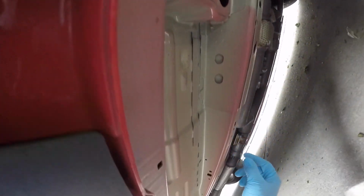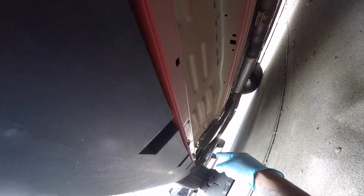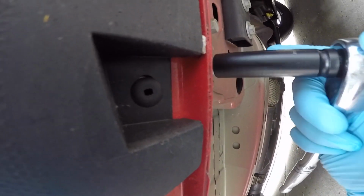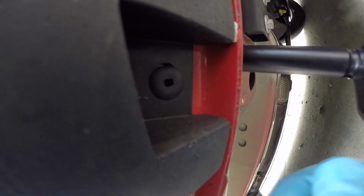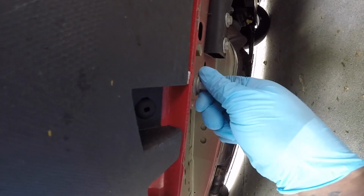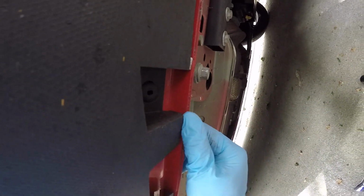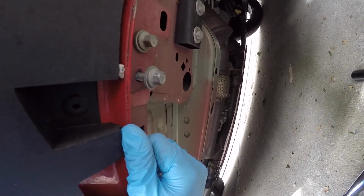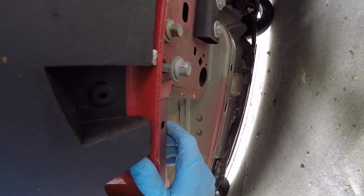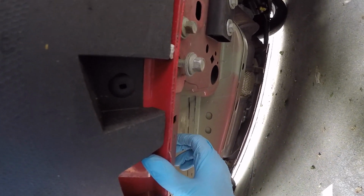All right, guys, so this is how you're going to put it on. There's 2 factory bolts here, and there's 2 more down there, and they're both 15 millimeter sockets. Once you have taken these out fully, then you install the jacking rails, and it's pretty easy. It should take you no longer than half an hour, jacking both sides up, about half an hour.